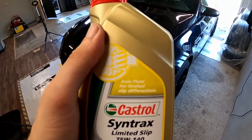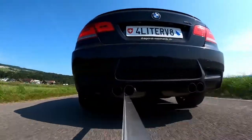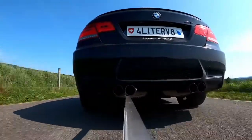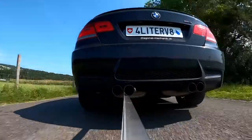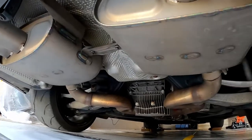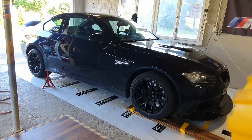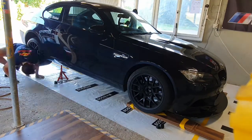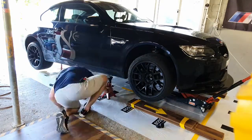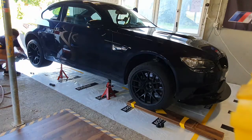The reason for the friction modifier being that some people have complained about the noise emissions from the differential, which is kind of in its nature, being an LSD. Nevertheless, BMW came up with this noise-reducing additive, but I'm going without the friction modifier because it's cheaper and I don't mind the noise. Furthermore, I like my friction unmodified in an environment where proper friction values are vital. Now, jokes aside, I think both are perfectly fine, and yeah, without further ado, let's get that sauce changed then.